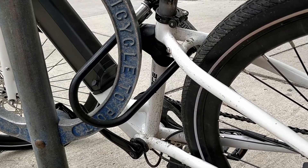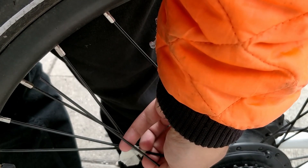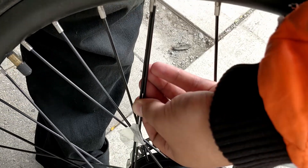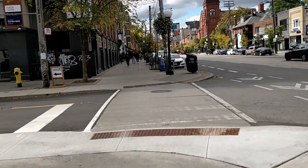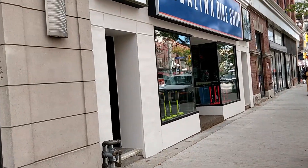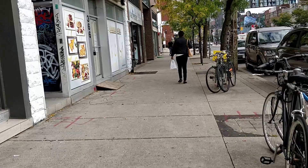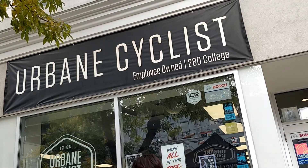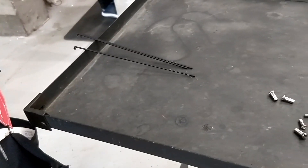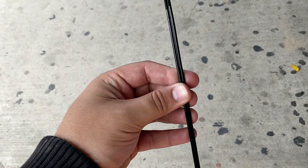Been meaning to clean this bike up again but I'll do that another day. I got the spoke, compared it to the broken one, and in my mind I thought maybe it's a little bit short — but I don't actually know how far the spoke goes into the nipple. So I brought it over to Pedal Links because they'd still fix it, I just needed the spoke. Turns out 190 was too small, so I went back over to Urbane and got some at 196 millimeters.